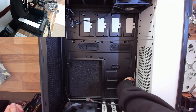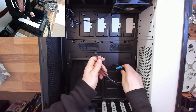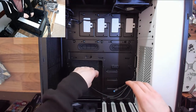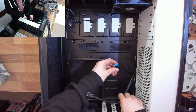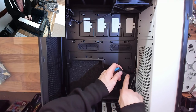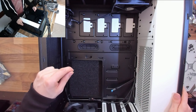In the main interior of the case we've got a selection of wires for the front panel connectors — USBs, audio, that kind of thing — and a couple of other accessory wires. I need to move these cables into the right positions. For example, this USB cable is going to go somewhere over here on the motherboard, so it's in the wrong place already. We're going to pull all of this out and reroute all these cables.